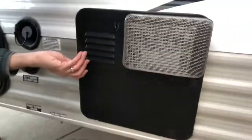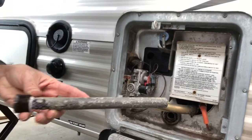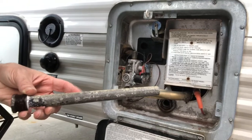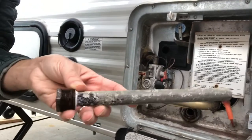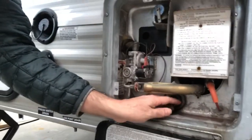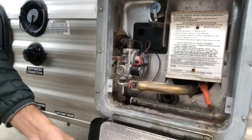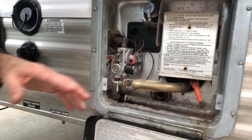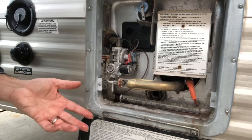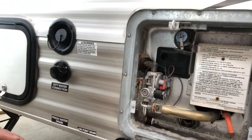The other thing you want to do is come to your hot water heater. This is your anode rod — a lot of people don't know about it, but it's designed to deteriorate so the inside of your non-stainless steel tank doesn't corrode. On this 2015 model the rod still has tons of life left. It also serves as your drain plug, so you basically unscrew it and pull it out — a bunch of water will run out. If your hot water heater was recently on, be extremely careful because it will be hot. Drain it out, then blow it out with the compressor.